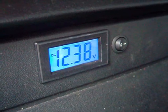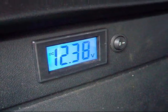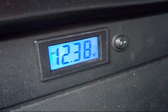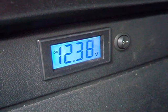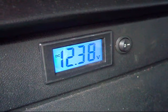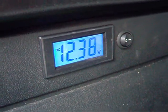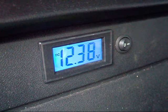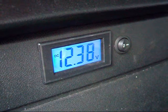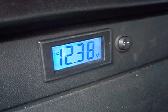Part two of the voltage display that I've added to the Type 25. Last time I showed this it was actually in the dark, and one of the changes I've made since then is putting the stereo on the leisure battery. I'm using two car batteries with a split charge relay. Obviously car batteries don't hold the charge quite as long, but it was a case of getting the stereo, which is a bit power hungry, off the main starter battery.